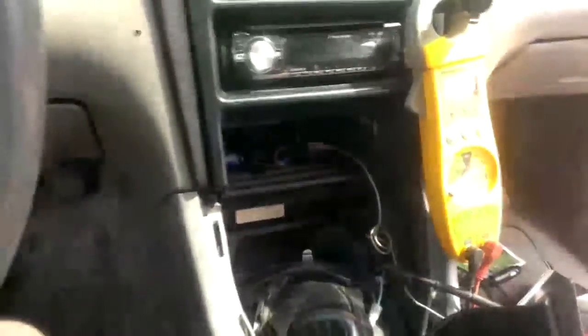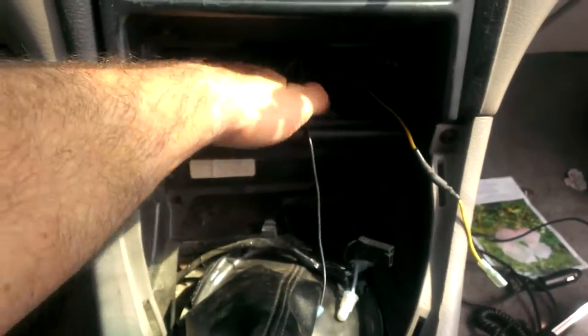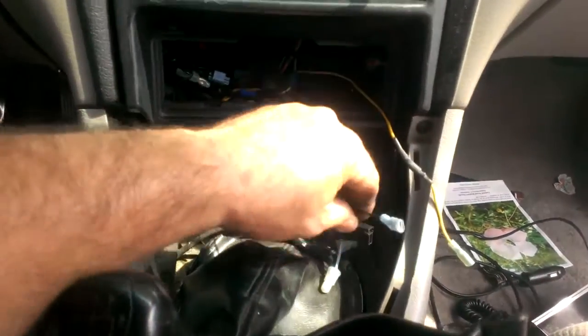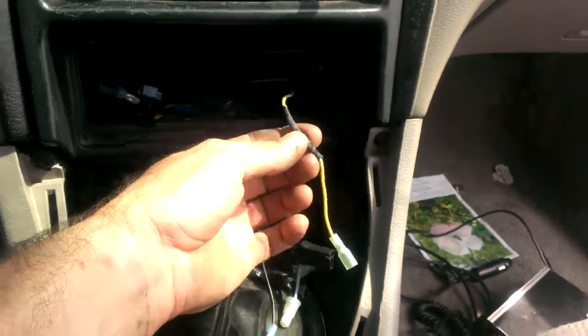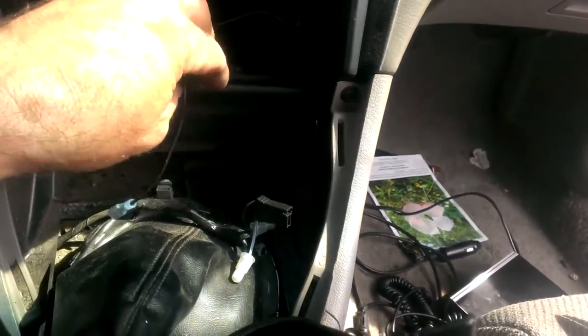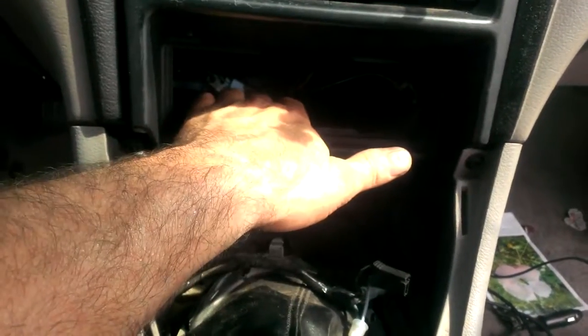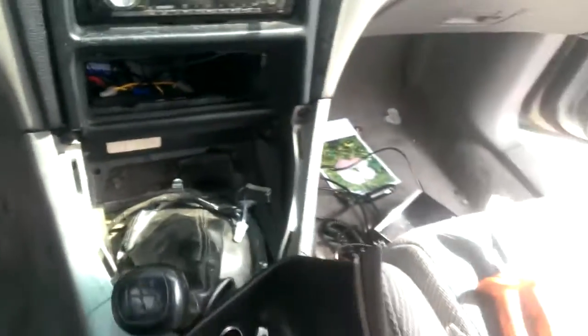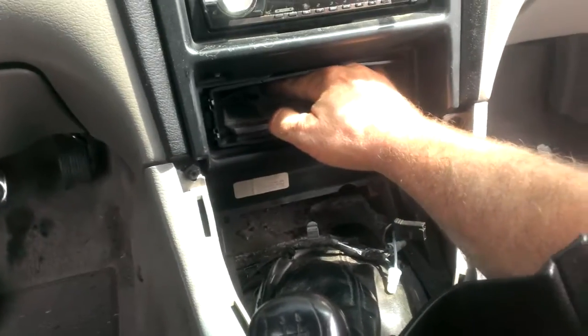So, a pretty simple mod. I'm glad I tested it — it's going to work to clear the computer when I just want to clear the computer. But when I want to disconnect the battery to do something on the engine, obviously that's going to drain and not hold memory. So I've spliced in two more wires — there's another diode in the shrink tube, so current can only go one way. I'll keep these stashed back here where I can reach them. I'm going to be able to connect one of my small 12-volt batteries to this — it's after the first diode, so it will not back-feed to the car system — to maintain the memory on the car stereo.